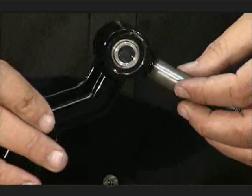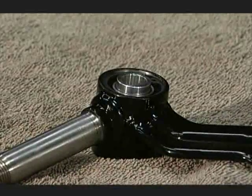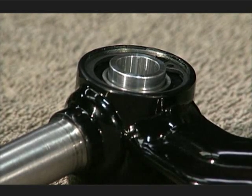If you notice with this design, because there's no load on the bearings, they turn real free. On old style spindles when you'd press them in, once you got them in the kingpins, the bearings wouldn't turn and the steering was tight — that's the main reason we went to this design. It's a good idea to rebuild your spindles as they get loose. If you've got a lot of time on your spindles or a couple of wrecks, you may want to consider replacing the whole spindle. But if your spindle's in good shape and not bent, spend a little bit of money and rebuild the kingpins — it'll take the slop out of your bearings and keep your caster numbers right. Try to rebuild your spindles during the week because the retaining compound needs approximately 24 to 48 hours to set up to its full hardness, so this is really not something we recommend doing at the track.